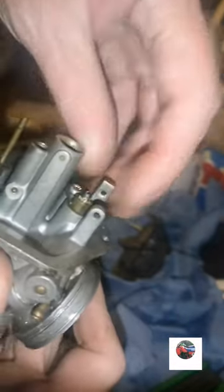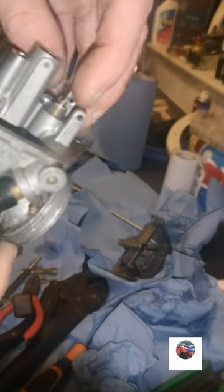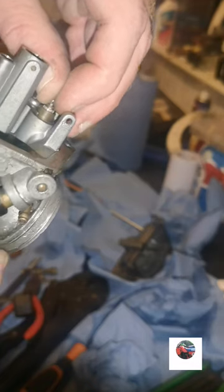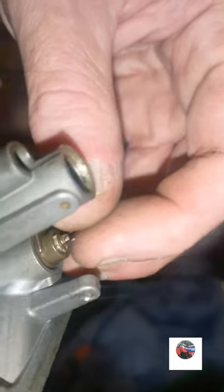It's because that isn't shutting like that there. Watch. Show again with the petrol pipe. See, if the floats are shut there, there's no petrol coming out. When the floats drop, this lifts up and petrol comes through here. So watch.